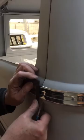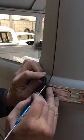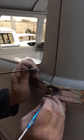We recommend that you observe the top of the trim as you progress around the corner, as that's the point your eye is drawn to, so you need to get it parallel to the body moulding. You may want to put a holding screw in halfway around the corner as you go to help hold it while you work it into shape.